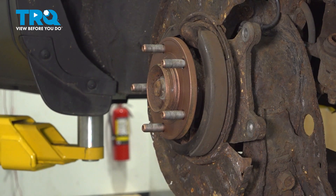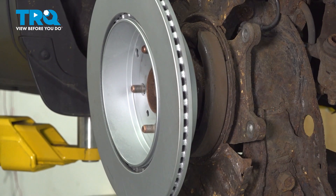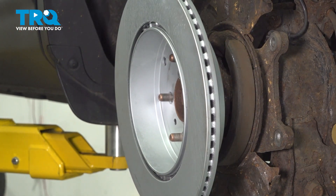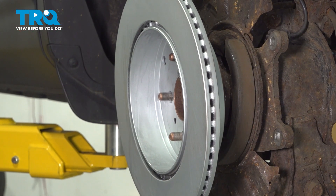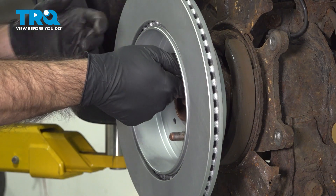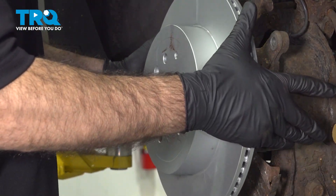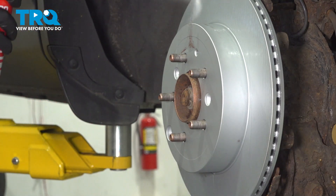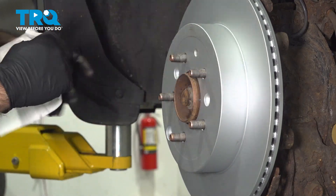We'll let that dry and we'll put our rotor up and clean our rotor. We're going to take our rotor and put it onto the lugs backwards. If you want to, go ahead and put a lug nut on there just to save your feet or toes if that happens to fall. We're going to take some brake clean and clean the surface that's going to make contact with any of our brake items — the interior where our pads or shoes for the emergency brakes are, and the exterior where our pads are going to go. Once we're done with that, take off the lug nut, flip it around, and do the same thing on the outside. Sometimes these ship with greases or oils on them, or you've gotten some oils or greases from handling — that's what we're removing now.